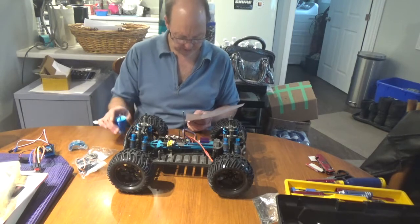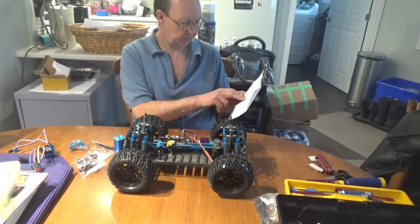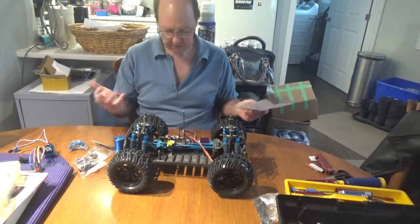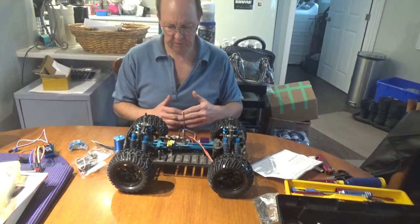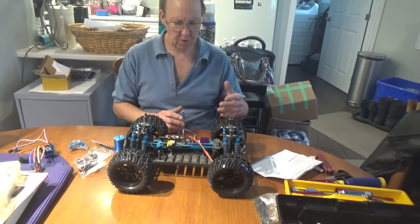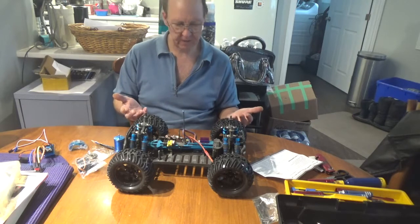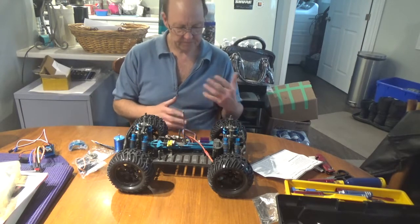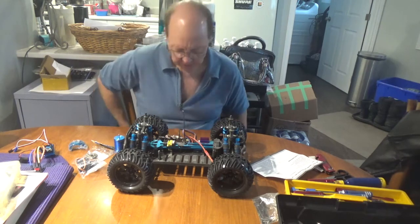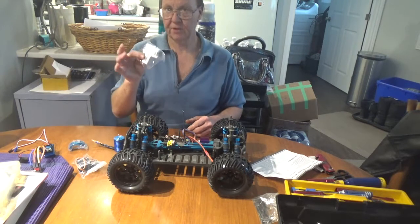Length is 50 millimeters, 36 millimeter width with fins for the diameter, and 3.175 millimeter shaft with a 15 millimeter extended shaft where your pinion goes. They have full spec lines for four different motors. I picked 3,300 kV because that's what it came with, and I didn't want to go higher in kV because higher kV takes a lot more to get going - you do get more top-end speed but we decided to stick with 3,300 kV and basically stick with stock. I got my metal spur in too.